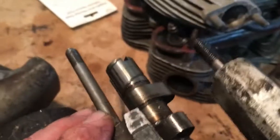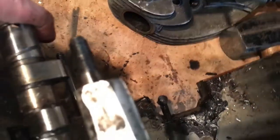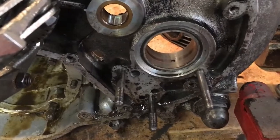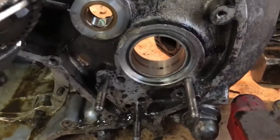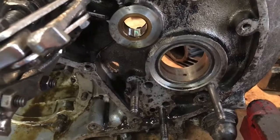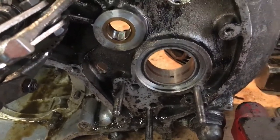On the cam itself, the cam end is good. Although very filthy and full of debris, the right-hand case is reasonably clean — no grooves. Lots to clean out but that's okay. The all-important main bearing on this side is within tolerance, which is amazing, but oil was continuing to be fed to it even while there were disasters happening on the other side of the engine. That bearing is unique to the A70 because there was much less room within the cases for the crank, and therefore this bearing is pared down a little bit compared to an A65 bearing — an A65 bearing has a shoulder on it, this one doesn't.